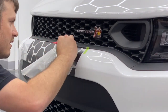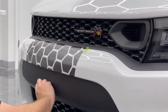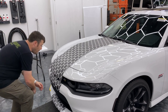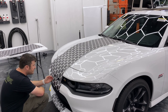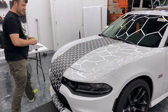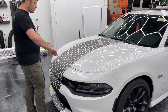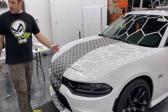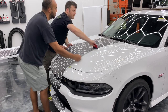There's no really perfect way to do this — just make sure you watch for any decals that want to come up with the paper. We already have a stripe on the bumper so I can align off of that, but if you don't, there is a center honeycomb in this grill and I am lined up with that. I'm still within my marks on the back towards the windshield. When I put my tape down I'm not putting it exactly next to the transfer paper — I'm putting it about a sixteenth or an eighth of an inch over, but it's an even gap on both sides. Being very methodical on how we're squeegeeing here.